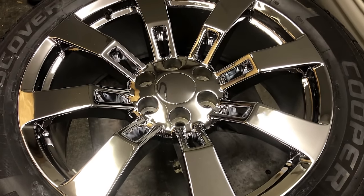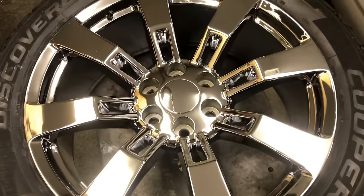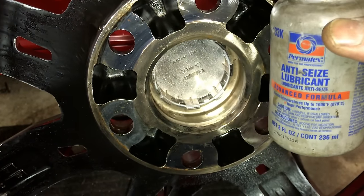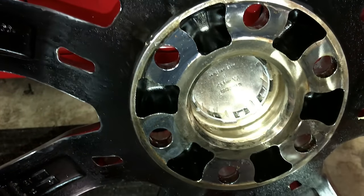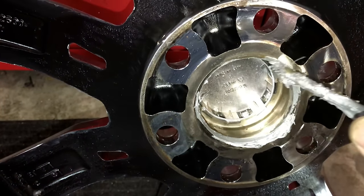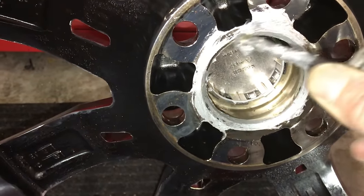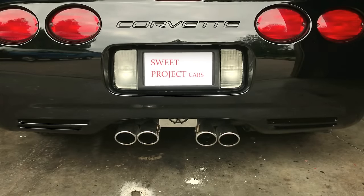There's the finished product — this will weather through any storm that mother nature can throw at it. Just a reminder: make sure you use your anti-seize right here and here before you put the wheel back on. Real simple — this way it makes sure you can get your wheel back off very easily. Glad you're here with us, come back again. Take care ladies and gentlemen.